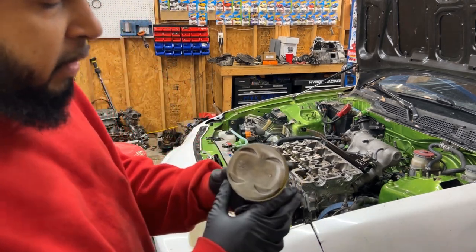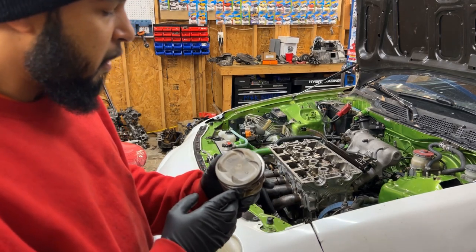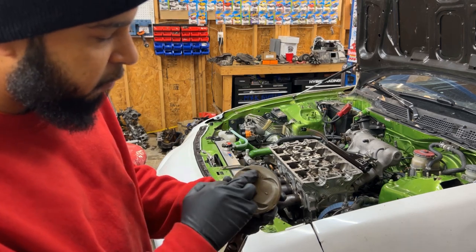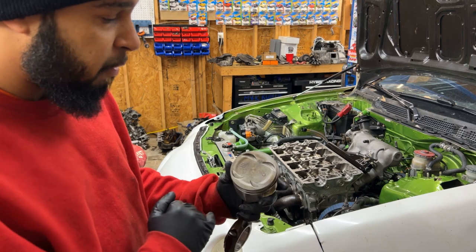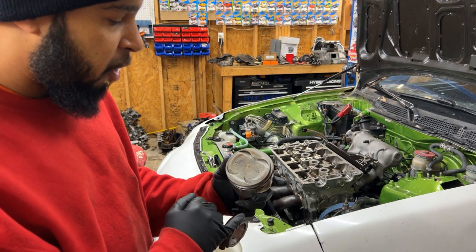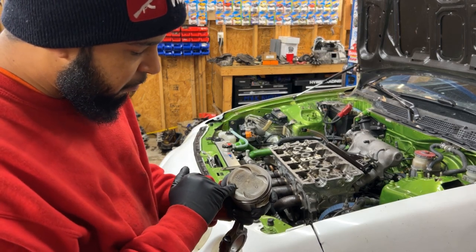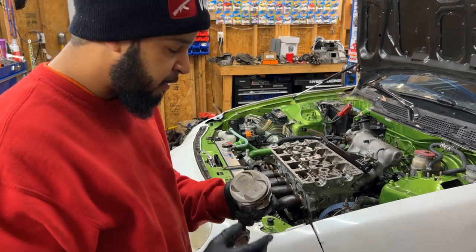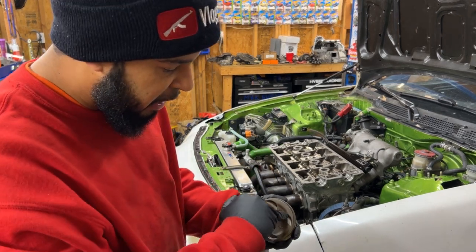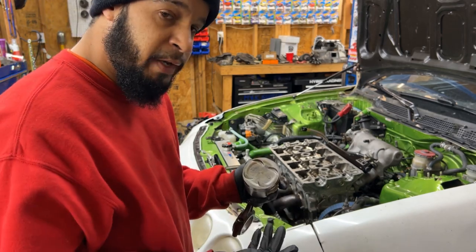This is a piston right here. This is pretty much an LS B18B1 piston. Right here, these are your valve reliefs. And on the B20, they're pretty small, a lot smaller. As well as on this other piston, the pistons that were used, it was actually made a little different here as well, compared to an OEM piston. So what I did, I got my Dremel and I made these valve reliefs a lot bigger because there was already contact.